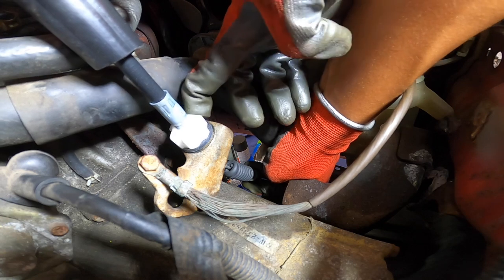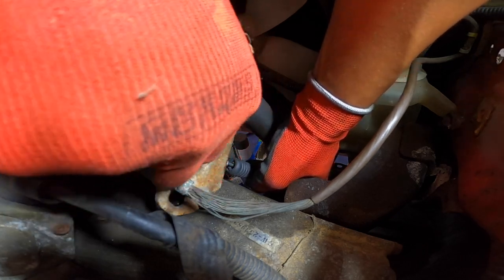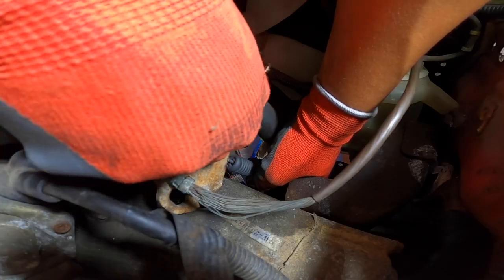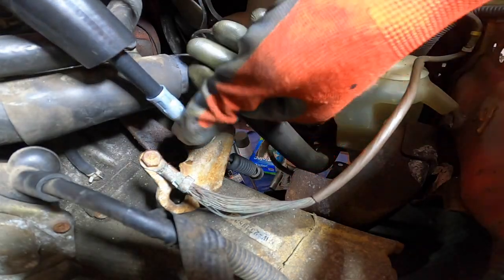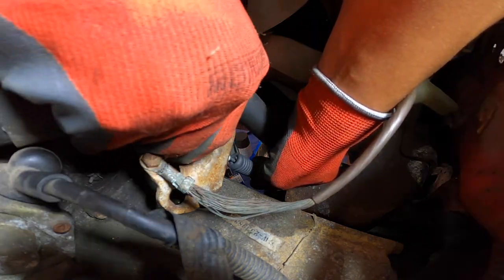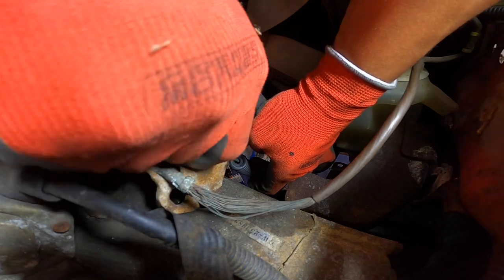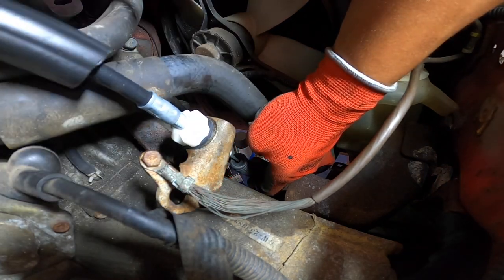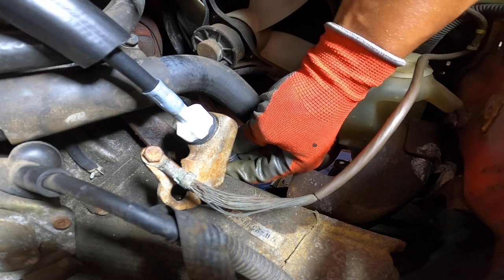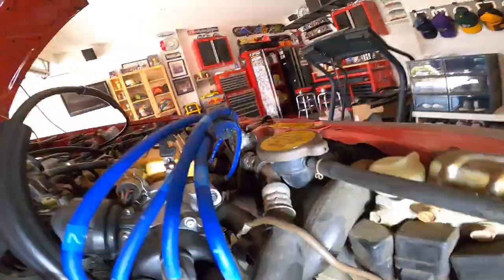Since there's play here, you're just going to push it up until there's no more play in the linkage, then tighten the cable using the adjustment knob until there's no more slack. The reason you want to remove the slack by hand first rather than just tightening the screw: screws have better mechanical efficiency, so you could be twisting the adjustment screw all day unknowingly putting load on the arm. Just twist until all the slack is gone and it's nice and tight. Also make sure the angle of your cable is correct — if the angle is off it can add more or less slack. Once it has no play, pull the boot up onto the threads.